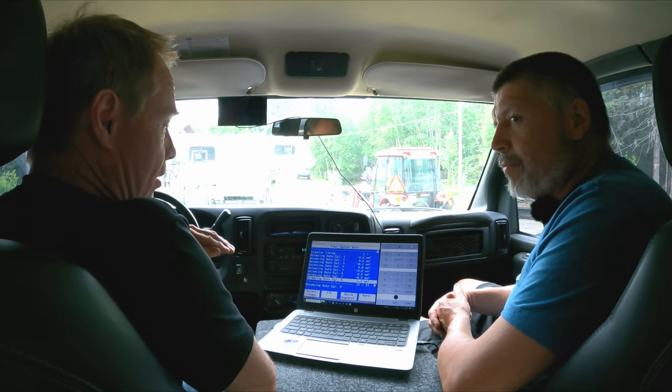This truck does have an emission system - it doesn't have diesel exhaust fluid but it does have a regen system. It's the first generation of the emission system: you have an active EGR, a catalytic converter, and a diesel particulate filter. After about 800 to 1,000 kilometers of driving, or after enough soot has accumulated in the DPF filter, it does a regen - basically like a self-cleaning oven, re-burning that soot into ash. You may notice at a stop that your idle is 150 to 200 RPM higher than normal in a warm condition - that means it's simply trying to finish its regen cycle.